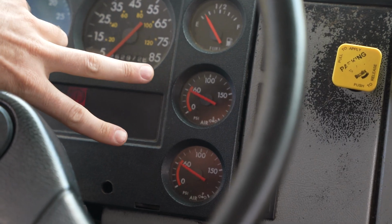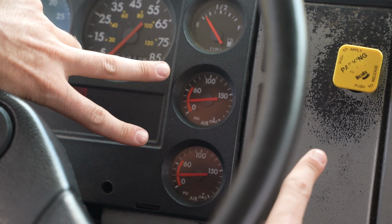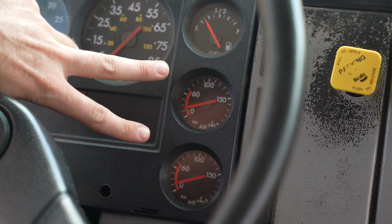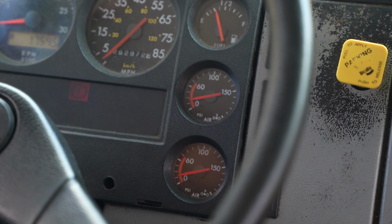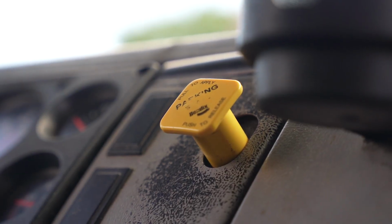Spring brakes. Say, I'm now going to check my spring brakes. They should come on between 20 and 45 psi in my primary and secondary air gauges, making the yellow brake valve pop out. Then say, the spring brakes activated between 20 and 45 psi. Do not touch the spring brake during this section of the test.